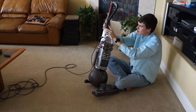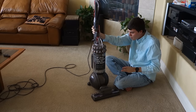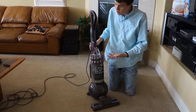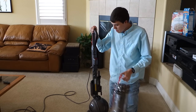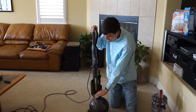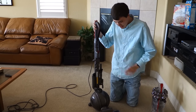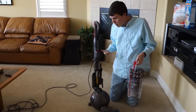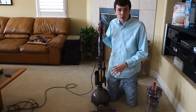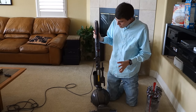If you're still having trouble and the hose does not work, you can continue with a few more troubleshooting steps. First, take the bin off, press the power button, and check for suction here. If you can feel suction, then there's probably an issue somewhere between the bin and the hose, which we'll now check. If you can't feel suction there, then you need to call Dyson, because there's an issue somewhere in the motor unit. They should be able to sort you out very quickly.